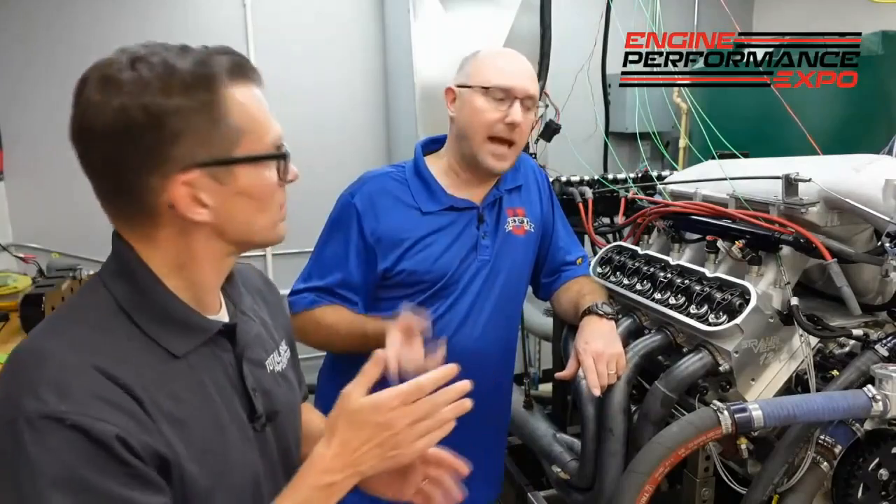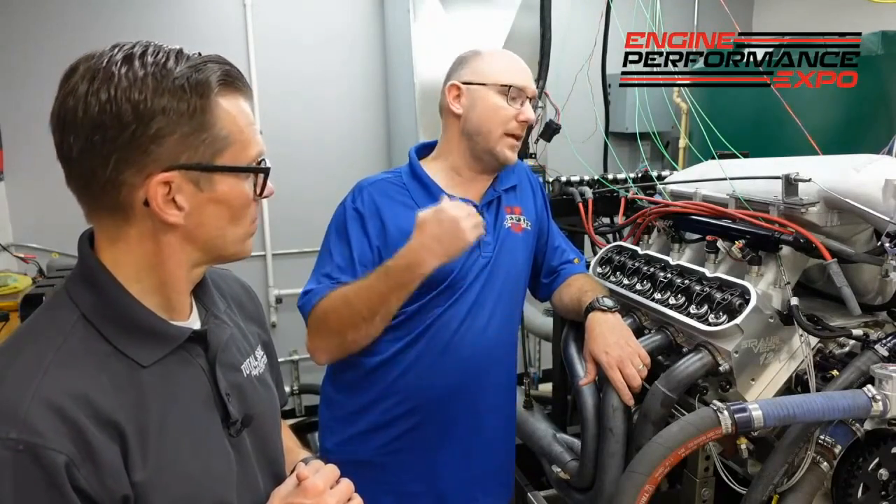Statically and just in vertical lift, the amount of loss wasn't that much different. However, the things that make a difference are not just the total amount of stiffness, but the ratio of stiffness to mass. We're getting the same stiffness out of this system with a way smaller, lighter rocker arm — less mass. We were also able to use the stiffer three-piece pushrod from Comp, though going stiffer on the Spintron first actually made it worse because we had to go bigger to be stiffer.